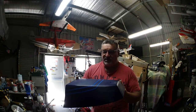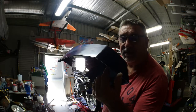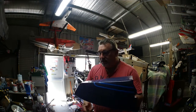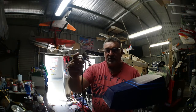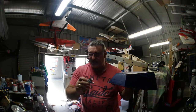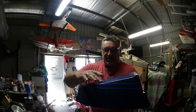As I said, the danger is that you cut through. It happened once on this, even though I was being careful, right on that corner there, and hopefully you can see that. Anyway, it's not the end of the world because it's only a very, very small part. So what I do now is I've got a little airbrush. I just touch up, because I'm at the painting stage, not the clear stage. I'll touch that up and you'll never know that I cut through. And then I can go ahead, and that's actually masking, so I've started to mask that up.